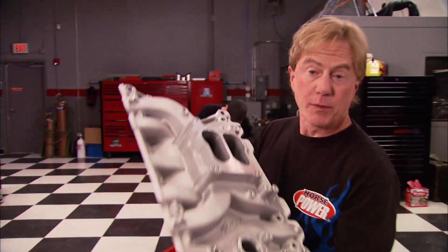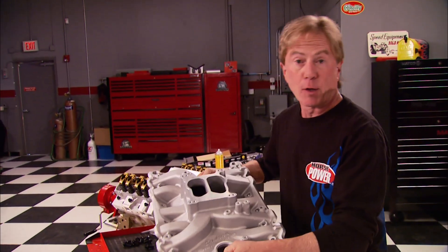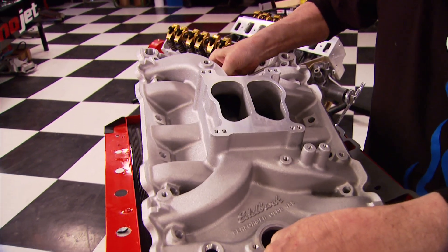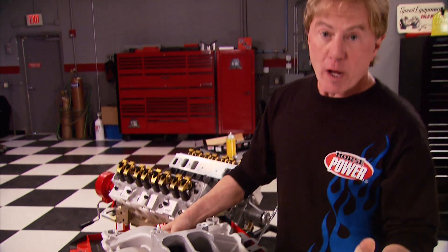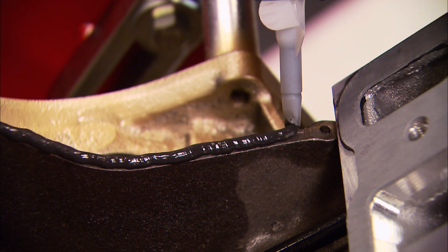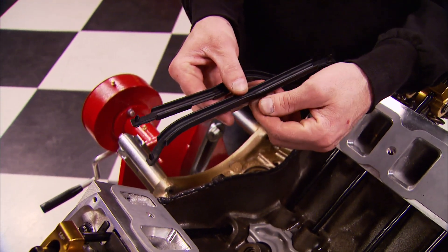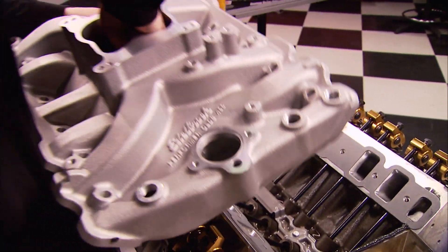We're back with our Olds build, and now with this aluminum intake. This Edelbrock Performer is a vast improvement over the cast iron original — it's a dual plane, low rise design made to give plenty of torque over a broad power range and throttle response from off idle to 5,500 RPM. They recommend a quarter-inch bead of silicone to make the seal, because rubber and cork gaskets can get oil soaked and crankcase pressure from the engine will push the seals out from under the intake manifold — that's end seal slippage. Take your time; you don't want to have to do it twice.